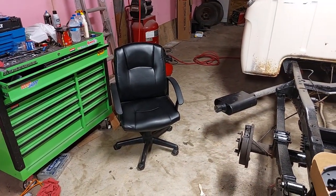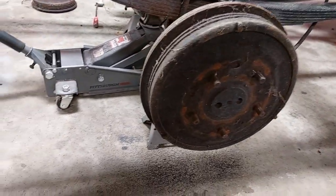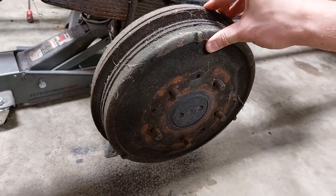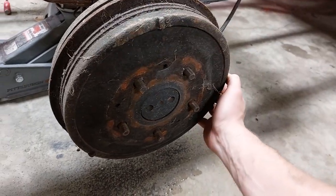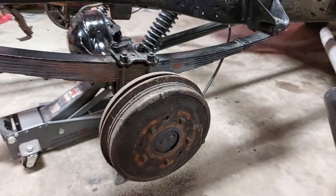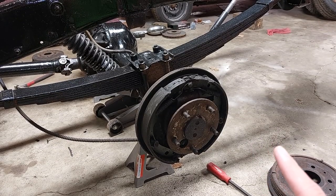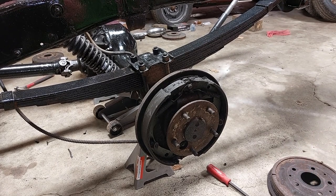Yes, I do sit in an office chair while I work on project vehicles. The drum was seized up on the other side — I'm going to show you just a couple of little taps here. Rust and corrosion cause it to seize up, and it feels like the shoes inside are sticking too. For right now I didn't order any other parts except for the shoes — I couldn't find a hardware kit anywhere, so we're just kind of winging it. Hopefully none of the springs snap. They all look good right now, but let's go ahead and start stripping this stuff apart and see what we can do.